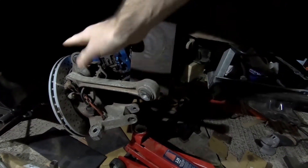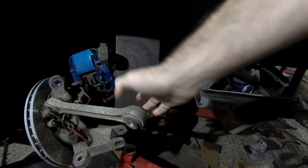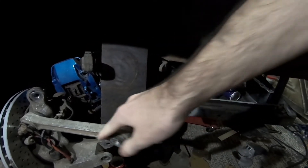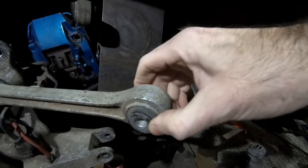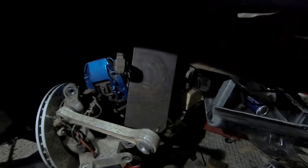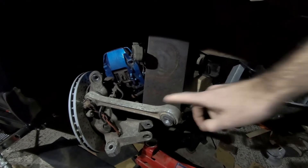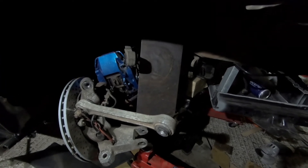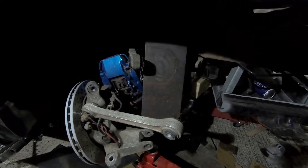Here's part of our problem. In order to get the drive shafts off, I had to remove different bits of the suspension — mainly the control arms, dog bones, that sort of thing. I do want to replace these at some point. The bushes are pretty rough looking, not in great nick at all. But I was hoping I'd do that and just button them up once. I think what I'm going to do is just accept bolting these bits back in very briefly, get the car out, and maybe even while it's outside, doing one corner at a time, get the new parts in. Let's get this bolted back in.